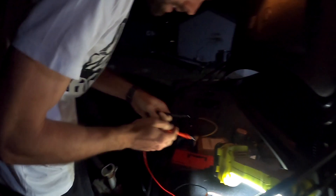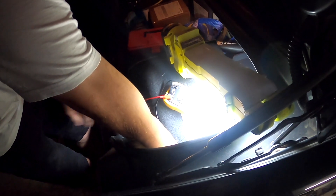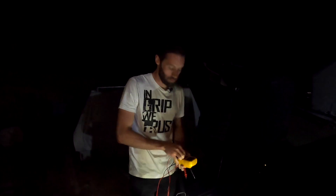You did actually start this up, what, three hours ago? Moved it a little bit? Yeah, and it was left overnight and it didn't drain the battery — it was fine. So, 7.9 volts. Today its battery drain went from full charge to 7.92 volts. Starting the car dropped it to under 8 volts in like four hours. Whatever starts sucking the power, starts sucking it quickly. It's very sucky.